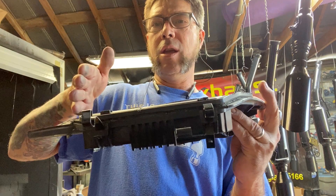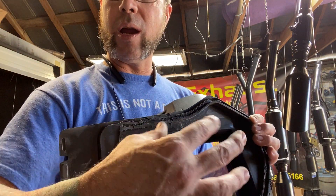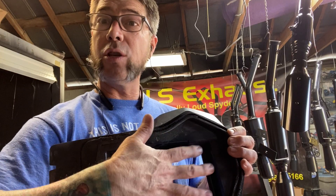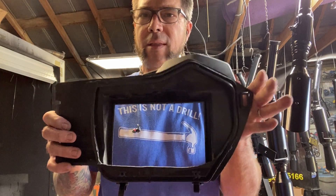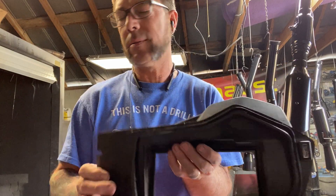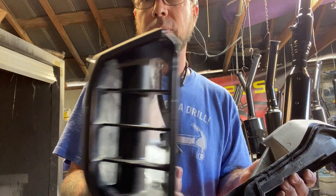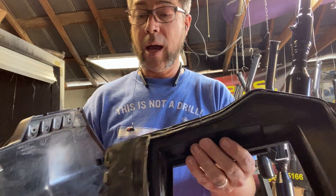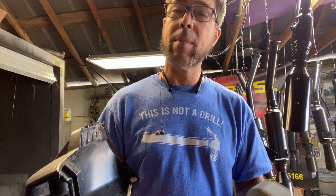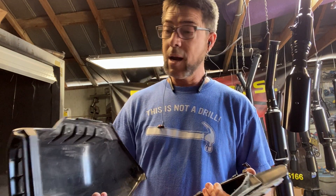The way this works, air comes in and goes into a little area, then through a hole and back into the airbox area with a bunch of obstruction. Well, if you cut all that away leaving it an open box area like this, then there's no obstruction. You're going to go straight through there and right into your air filter. That is going to give you a lot more airflow — it's going to make this thing breathe, it's going to sound different, it's going to perform a little different. I highly recommend an airbox mod like that.